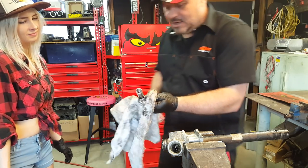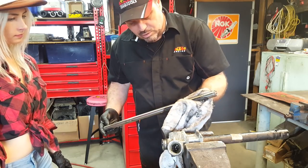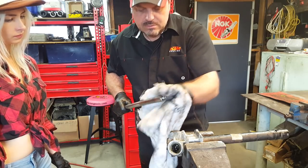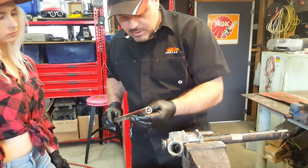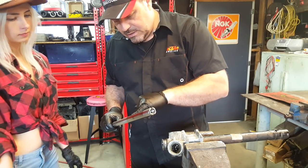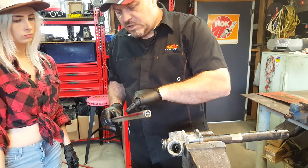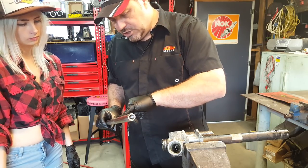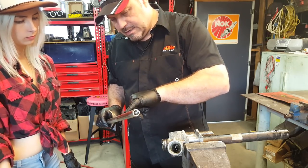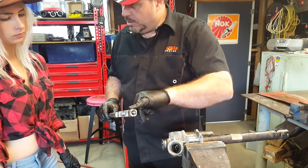Anyway, so you can see that linear gear now on there. It's actually in pretty good nick. There's no rust on there. Now, those heat marks, that discoloration of the metal, just down there, look. That's because in manufacture, they have to make those teeth really hard so they don't wear down. So they use heat treatment. And that's the colour. When you see a metal change colour like that, you see all the rainbow colours in there. That tells you that it's got hot. Now, in this case, it's a deliberate got hot.